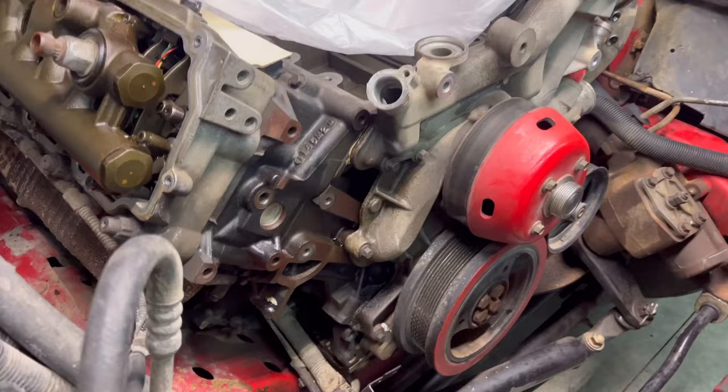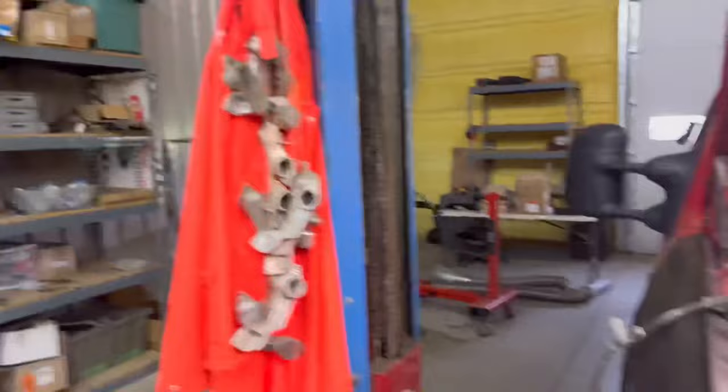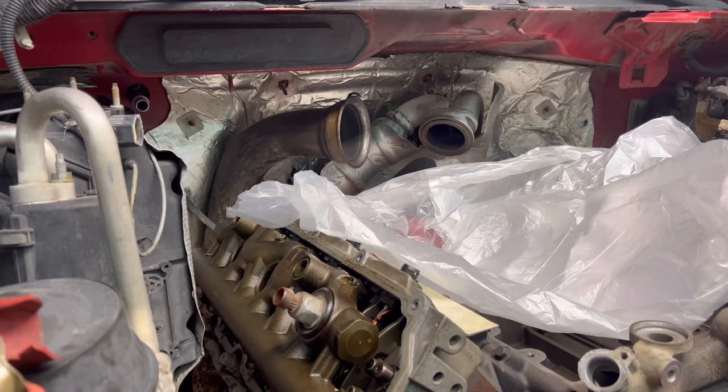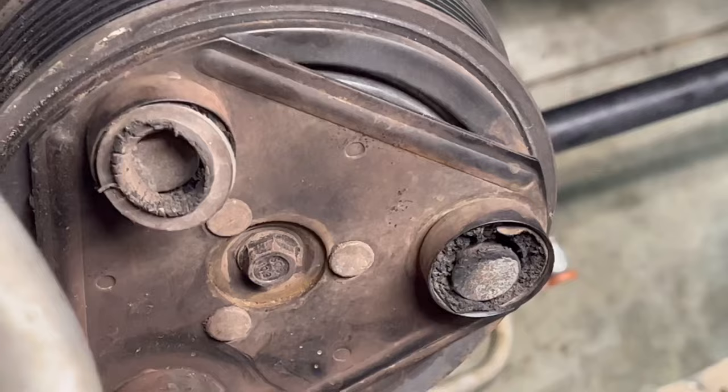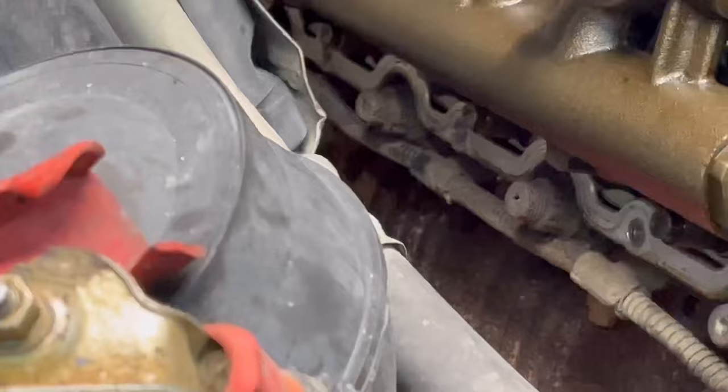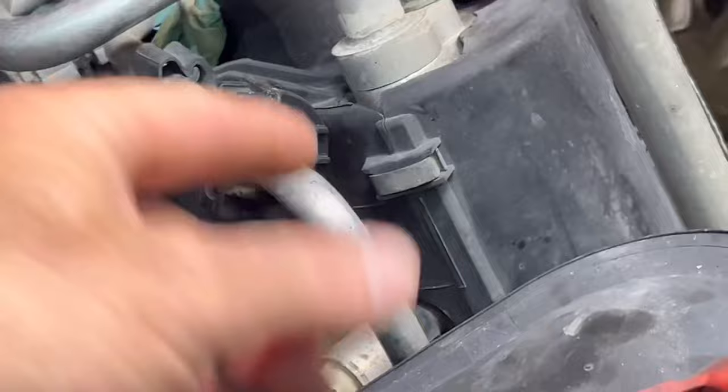I think we have a new dryer here, so we're going to put a new dryer on it. Ideally we'd also put a new AC condenser. Cleaning out AC condensers is a pain in the ass, especially when they only cost about $100. Out here I might go ahead and clean the condenser. We'll use a can of brake clean, shop air and a blow gun and blow it through both sides. We'll have to do that to the heater core and the evaporator core too. The orifice tube is in there — go ahead and pull the orifice tube, get a health inspection. If you check the orifice tube and replace the dryer, you have both lines completely open, so you might as well throw some cleaner through and clean it out.